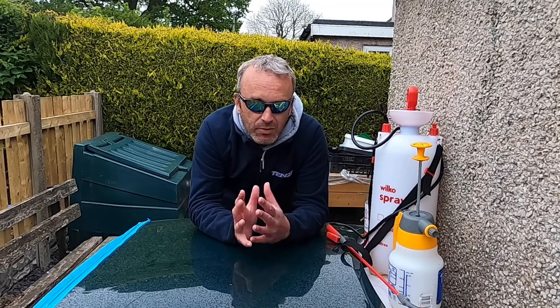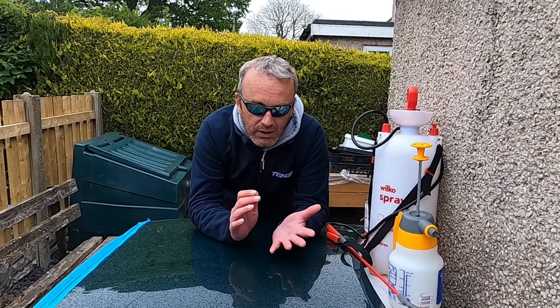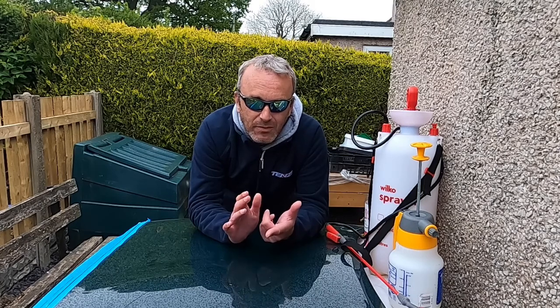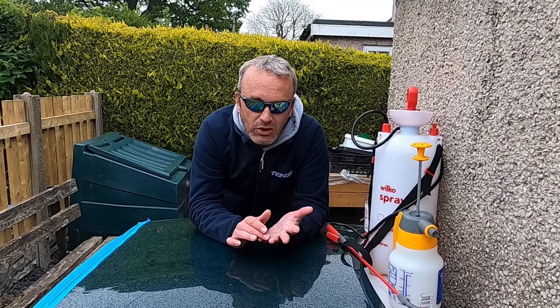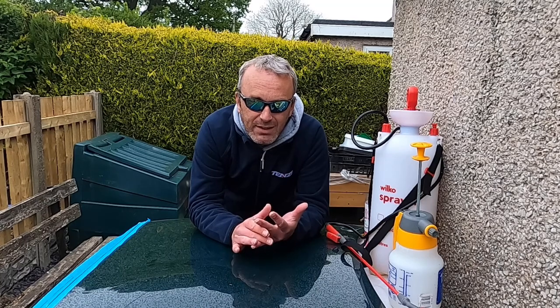All right, I'm going to do a separate tutorial on TFRs and citrus pre-washes, but this is just really aimed at the beginners. So like I say, read instructions, look at your dilution ratios, know what you're doing and what you're using. Do not apply it to hot paintwork. Do not apply it in direct sunlight. Wash it off straight away. Thoroughly wash it. And so the main top tip is, keep on top of your paintwork, keep it protected, so you can naturally go to a more subtle or a safer pre-wash chemical.